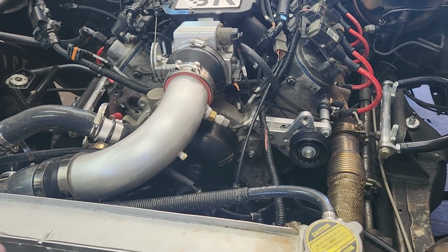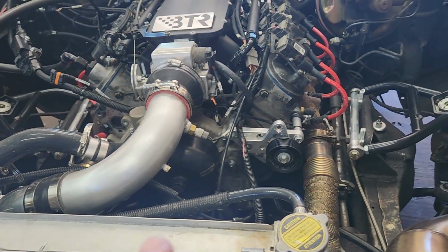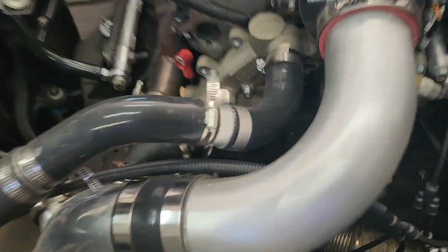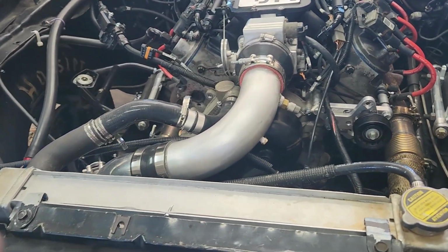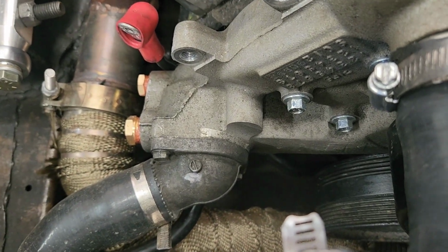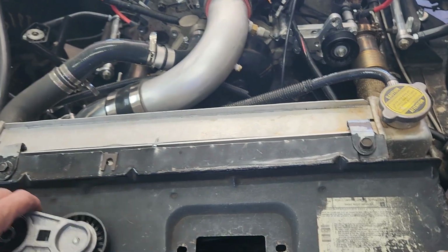But anyway, when we had the truck one, we had this, and we had the Chap Performance bracket, and we just tightened it up with that, and we left that off. And it cleared the water pump, or the thermostat housing, and everything was good. Well, when we did that and spaced it out, now it would hit the water pump housing for whatever reason. I guess it sticks out farther on the LS1 water pump. Anyway, we had to put this back on.